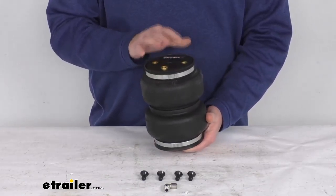This spring combines the adjustability of air springs with the reliability of internal jounce style springs. The spring will reduce the strain on your rear suspension, increases safety, and compensates for uneven loads. It will level your vehicle front to back, help maintain safe headlight aim, and these will adjust independently for side to side leveling of any off center loads.